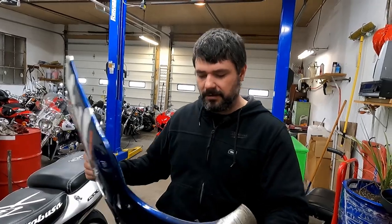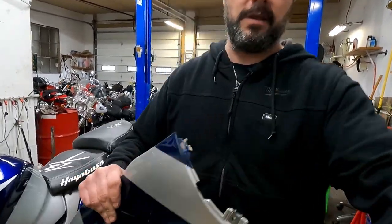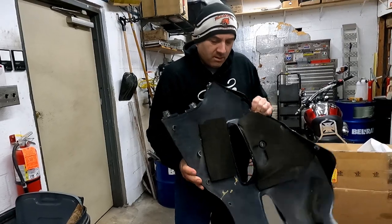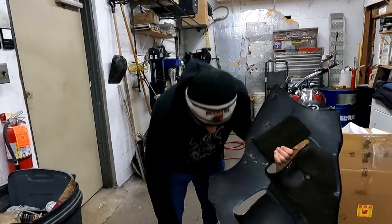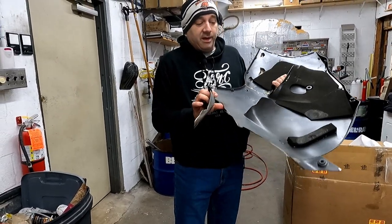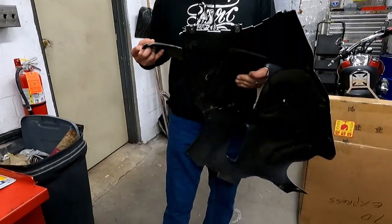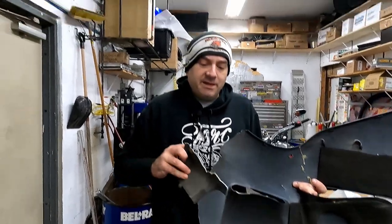And just based on this alone, I mean, if you feel that, Josh, let me hold the camera. Just feel how rigid that is compared to regular ABS. Just that fairing, like I said, you know what I mean? The couple things that you have to think about is heat, sunlight, all those types of factors go into why these plastics eventually become more brittle. So there's a big reason as to why we always tell people, try to keep your bike parked inside, keep it clean, keep a protection on it, because any of that stuff's going to help keep the UV rays from deteriorating the plastic, and the rigidity and also the flexibility in it. You need a little bit of that.